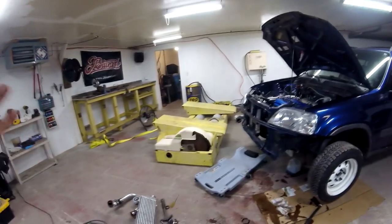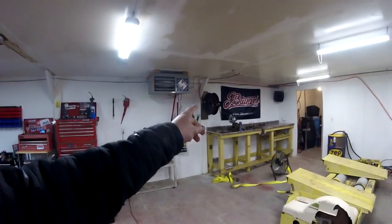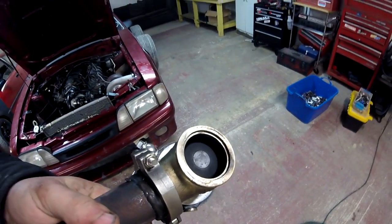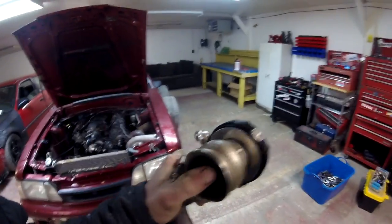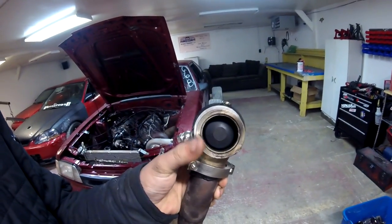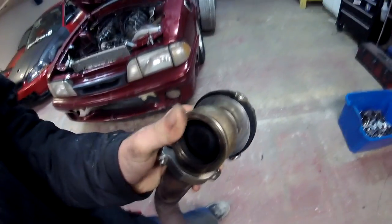All right, so I've been working on the CRV and we got a lot of stuff pulled off the car. I got the intercooler and some of the piping removed, pulled off the manifold and turbo — that's up on the workbench. This is the wastegate that was on it, and there is a gap between the valve and the bottom of the gate, so exhaust is able to flow right out of the dump tube because the spring or something is bound up under the diaphragm. If you had run this wastegate on there the turbo would have been really lazy and probably would not have made any boost.